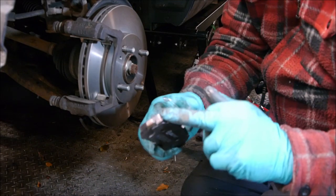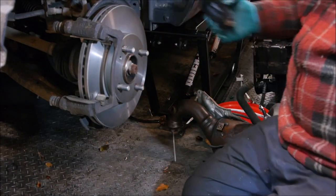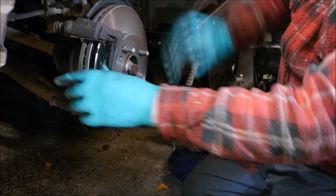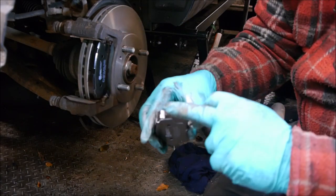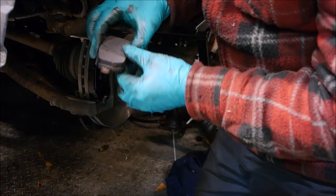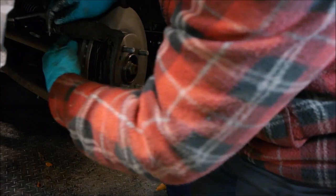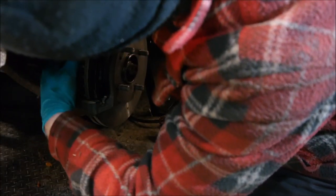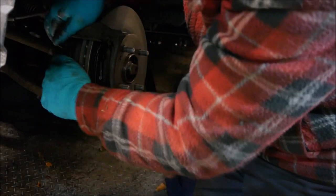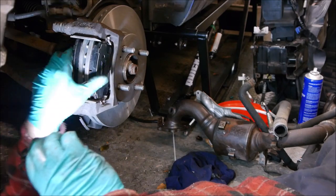All I do now is put a little bit of grease just on the heel where it runs in the runner, and just a little bit on the faces where they touch — that's all, you don't need to smother it in grease. Then you just pop the first pad in. Second one — just a touch of grease on the end, not much, but on the back where it rubs on the caliper and piston. Try not to get any grease on the brake surface or on the pads — that's not going to be a good thing. The pad simply goes in — give it a bit of a twist and push the pads in.